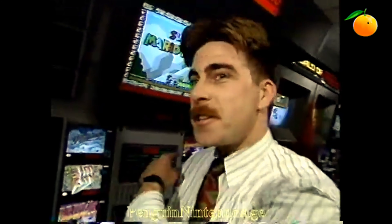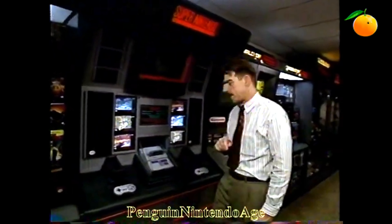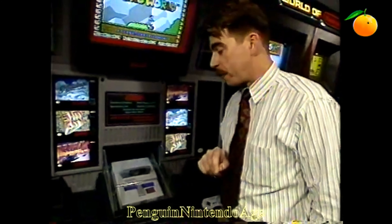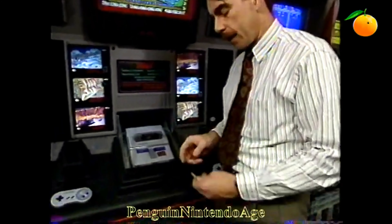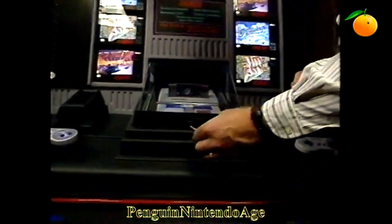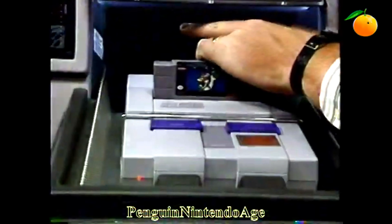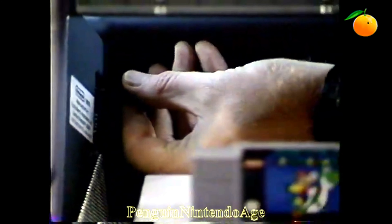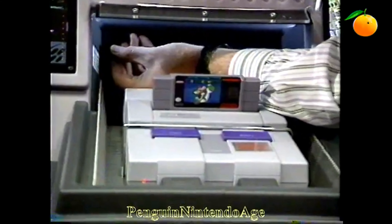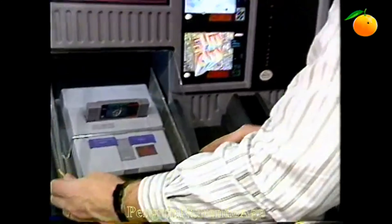Only three more to go. Here we've got a Super NES interactive — you've seen this before and changed the game pack out, so we'll skip that. But on this one, the volume is a little bit tricky to find. Take your key marked MM101, unlock and open the cover. Looking way up on the left-hand side, there's a little tiny knob to adjust your volume. Use that to adjust your volume up or down. Be sure to close your cover and lock it.